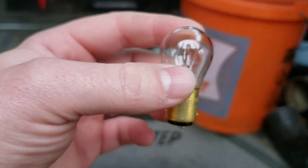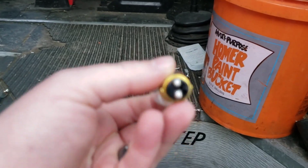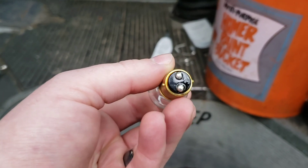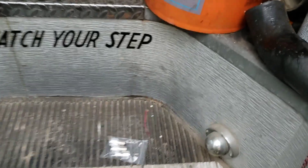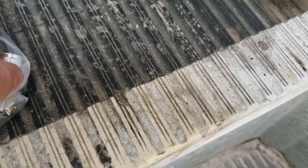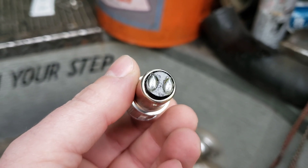The way these work — these actually were marine bulbs before becoming school bus bulbs. Instead of both pins on the bottom being positives for the different filaments and grounding through the base like a normal car light bulb does, the stop arms are aluminum but they don't ground very well. So one of those pins is a ground and the other one's positive. I was able to find these guys and they're an exact match. They are dual pin — these are red LEDs — so they have dual pins on the bottom, one's hot, one's positive, one's negative.